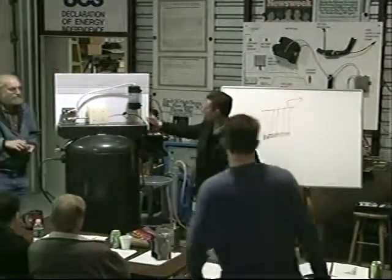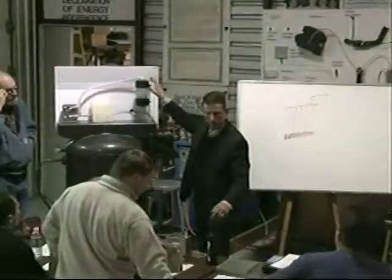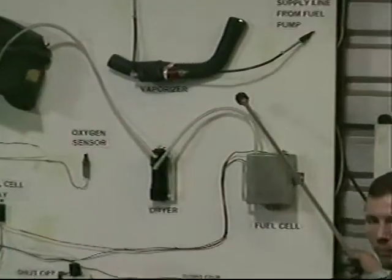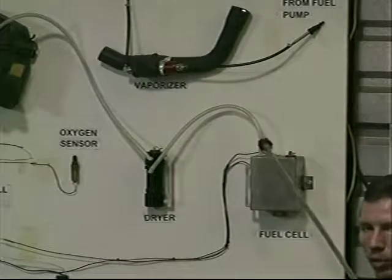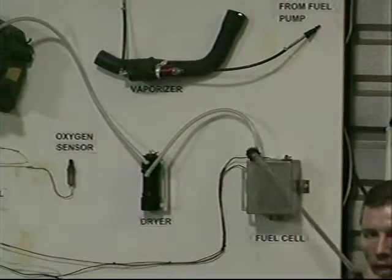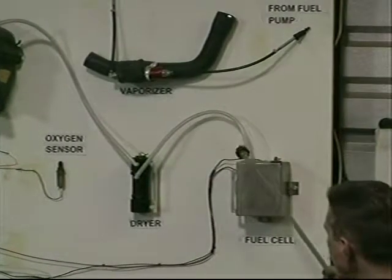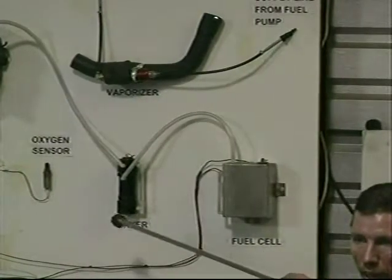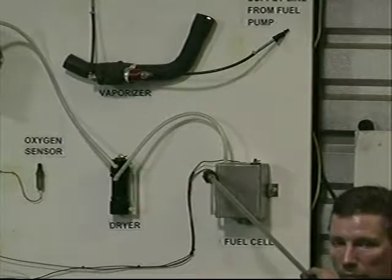So does everybody understand this? We're going to take this and run it to the base of the air cleaner, just like we would coming off of this. See how the hose comes straight up on this? Because if you're going to get mild foaming going on in here, gravity will pull it back down. Whereas if you just came off on an angle, if you get the foam up this far, it's going to get pushed out the rest of the way. Whereas with this, if you get a little foam, it might just drop back down.